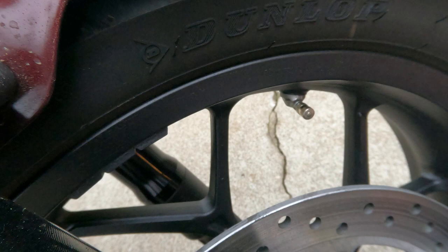Check your tire pressure frequently with a good quality gauge. Heat from the road can increase tire pressure, so make sure you check your tire pressure when your bike is cold, meaning it hasn't been ridden in at least 30 minutes. Be aware that gauges at gas stations are rarely calibrated. Being off by just a few pounds per square inch can alter ride comfort and your safety. Not all gauges are equally accurate anyway. You want a gauge that is correct for your pressure range — this can be a challenge.